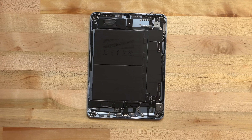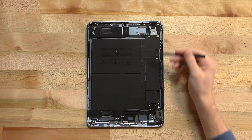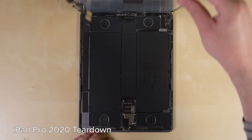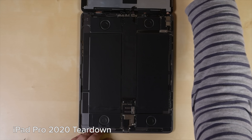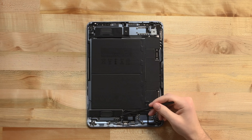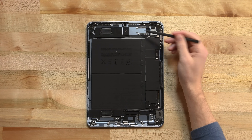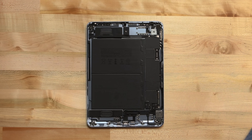Inside the new iPad Air, you'll see a few notable changes. The first is the logic board now lives on the right edge of the iPad — we usually see Pro iPad logic boards centered inside the device, surrounded by a battery cell on either side. You'll also notice there are only two speakers instead of the Pro's four, but the same magnet configuration means this will work with existing 11-inch iPad Pro cases and keyboards.